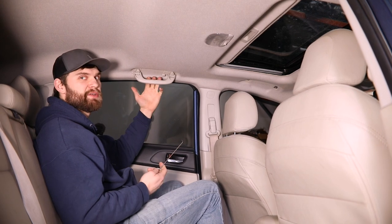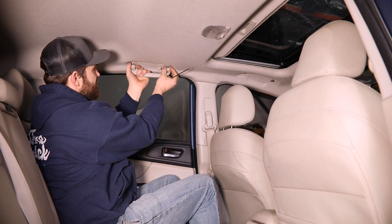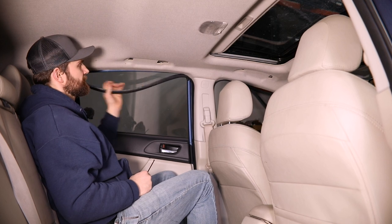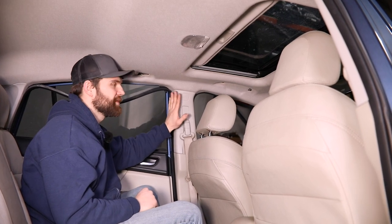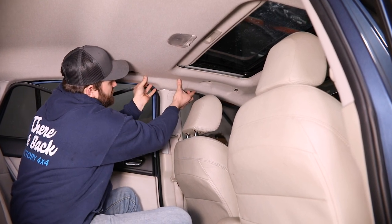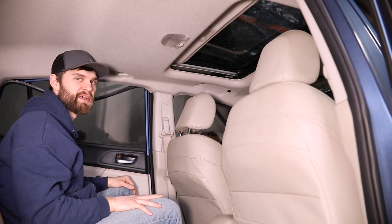Here in the back seat, this is going to be the same thing you did up front — you just need to remove this grab handle. Again, just using your pick to release these plastic caps and then pulling that straight out. Once you have that out of the way, just pull this door seal down just up at the top to give you room for that headliner to settle down. And one last little thing here: to allow this headliner to settle down the rest of the way, you're going to need to get it out from over the top of this trim panel. Just push straight up and then pull out on the bottom edge a little bit — that should give you enough room. Just be careful not to be too aggressive so that you don't leave a permanent crease in your headliner.